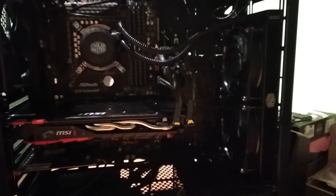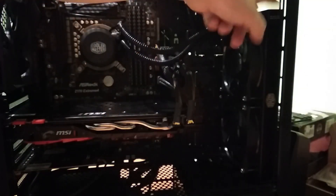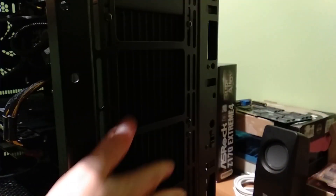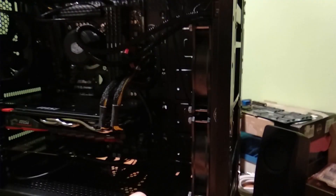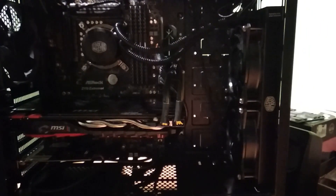Okay, I installed the liquid cooler. The first part was attaching the fans to the radiator with four screws each, and then I attached the radiator with eight screws to the front panel. This is the best place for it — it's far from everything so it gets cooler air. On the top it just doesn't fit because there's very little space — the radiator would fit but the fans wouldn't, and putting them on top would look too ugly.